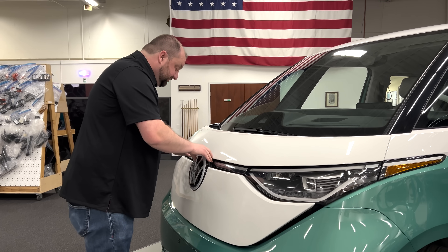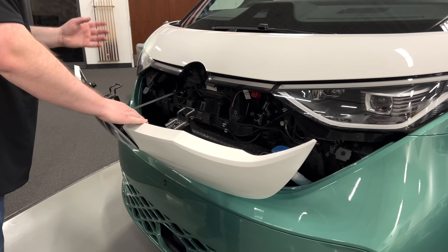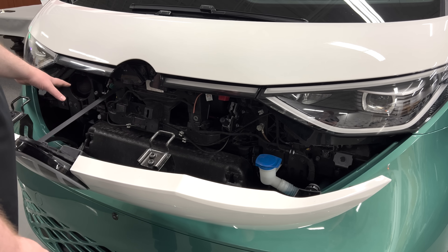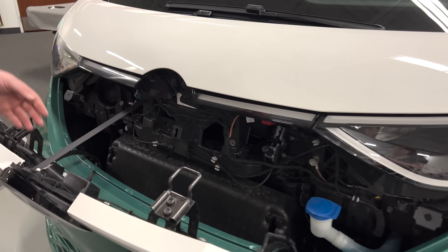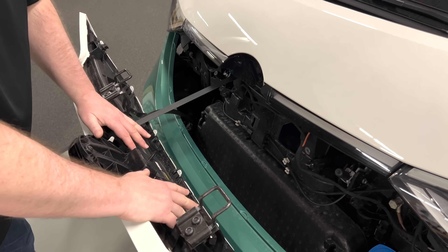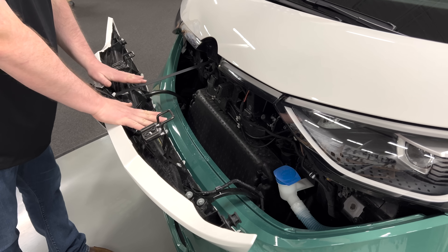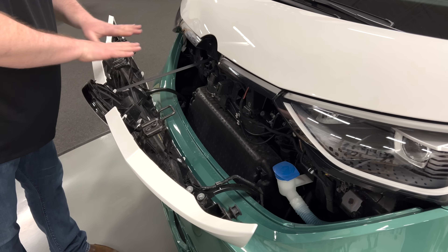Pulling the latch, this panel pops out and actually pulls down. The only thing I really have access to is air conditioning and the windshield — probably the only things needed for service. A customer would not touch that but would be exposed there. I do like the fact they put in a little check strap. We do have hinges, but by flipping down this becomes almost a work surface. Someone is going to be leaning on this. Personally I don't like that it goes down — I think it should go up. If it accidentally gets hit while up, it just closes. If it gets hit while down, I'm going to break something.